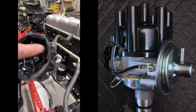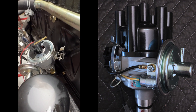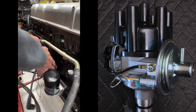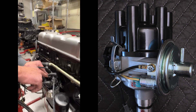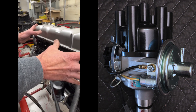We can put the cap on — there's a little groove notch right there, and that goes to that little guy. The notch goes there, put that on and clamp it. Then obviously you're going to hook your electronics up. Number one — the cap is nice enough to give you the firing order: 1-5-3-6-2-4. Put your plug wires in.